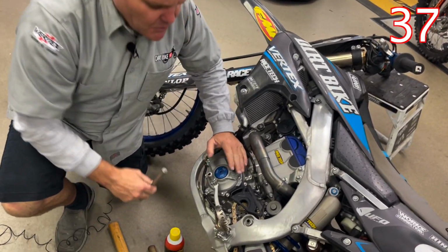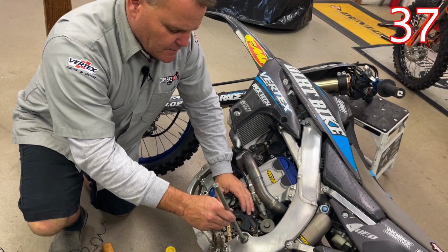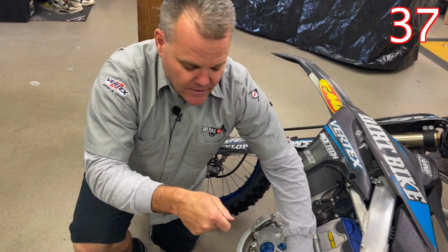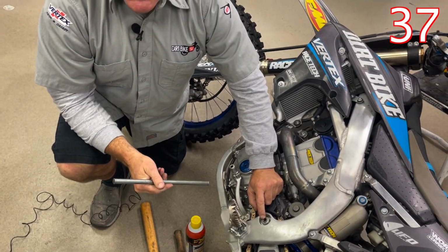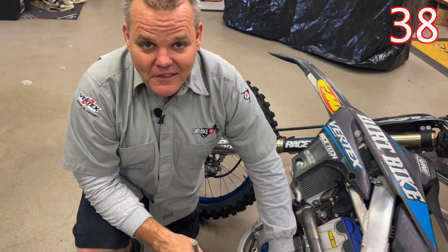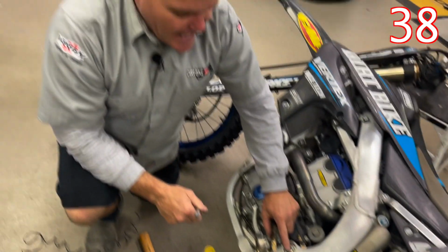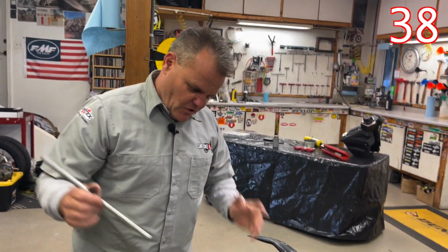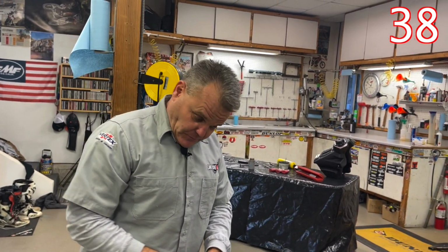And then once you get it to move, then you're going to need a longer rod like this, preferably aluminum, not steel, and you're holding it like this and giving it a tap here. You don't want to use a punch. We've seen this happen tons of times, and I'm laughing here because you get it stuck inside the hole, and you get it to move, and then you can't get the punch out of here. Very common. And that's been terrible. We've had that happen a few times. I've seen it happen over at Brad's a few times as well. So that should help you out in getting that unstuck if you're stuck.